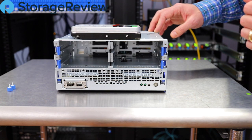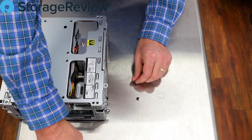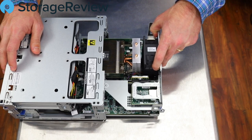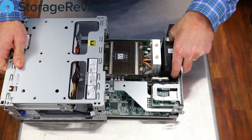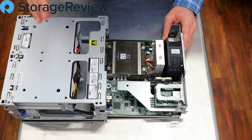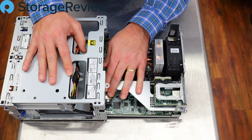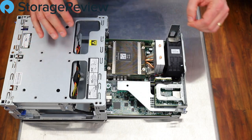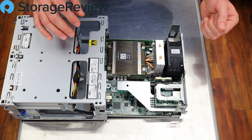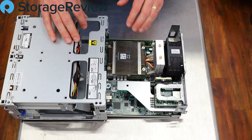We've moved the camera to an overhead position and removed two more screws that hold the board in place. This gives us a great shot of the internals. This is a pretty neat design from a serviceability standpoint — sometimes there are sacrifices made when you miniaturize something that make serviceability harder. With the tray pulled out slightly, over in the corner we've got the data leads and power leads for the four SATA bays in front. Tucked underneath we've got our PCIe expansion slot that'll work with 10 gig cards or a dedicated RAID card. The iLO on board connects over here to the management port.